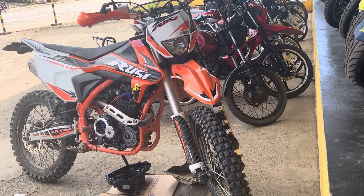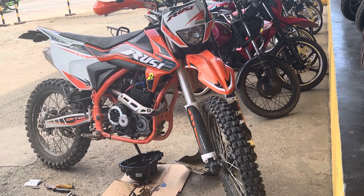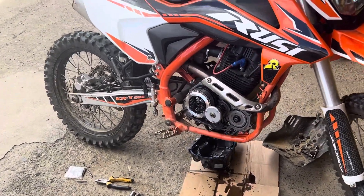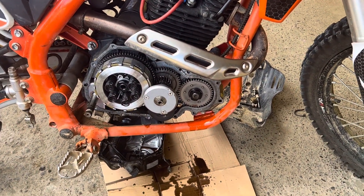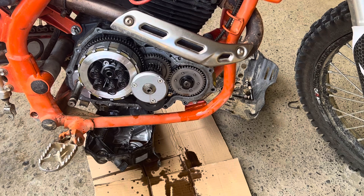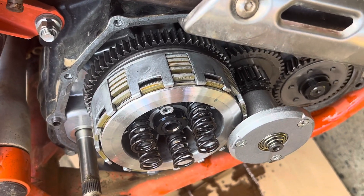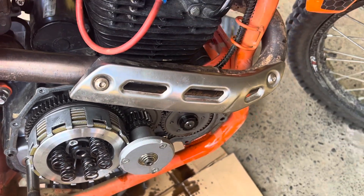Now I notice on the trail when you're riding clutch hard and you've ridden a while, it's overheating and locks up and won't shift — just very hard to operate in various degrees. So today we're putting in a Honda TMX pressure plate and clutch fiber plates, and we're putting in Sniper 155 springs. The stock clutch plates are heating up and expanding under heat, so that's a problem — at least on mine.